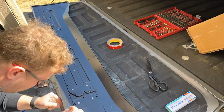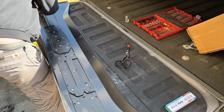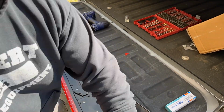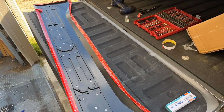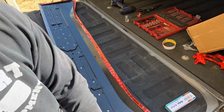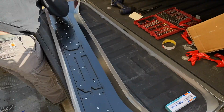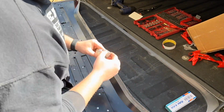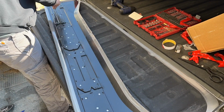After doing that, I'm going to hit all the edges with an adhesion primer that comes with the kit before putting down the double-sided mounting tape. And after doing the tape, when removing the liner for it, just go slow. It was trying to lift the tape on me and kind of stretch it out in some areas as well. But after doing that, I am adding some more of that primer around the edges of the tape before putting glue in the center of the applique.